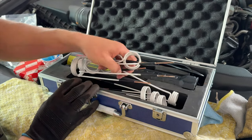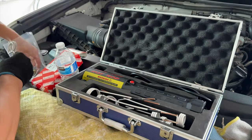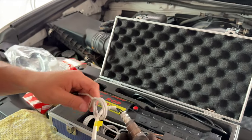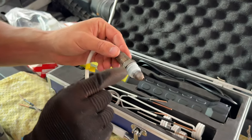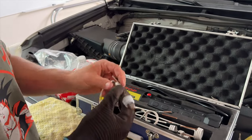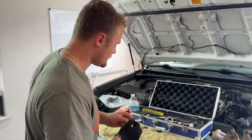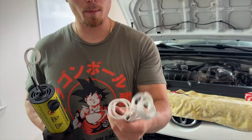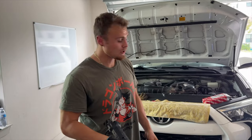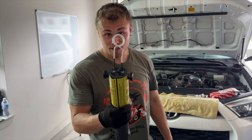You get these copper coils — we're going to wrap one around the end of the O2 sensor and heat that piece up red hot. We're trying to break whatever corrosion is in there. We'll get it red hot, spray water on it to cool it down, and do that two or three times. On the last cycle we'll spray some WD-40 on it, and that should break the seal so we can back it off pretty easily. These coils come pre-coiled, but I made a custom one to fit around the sensor — just take a socket and wrap the coil around it to get the perfect shape.